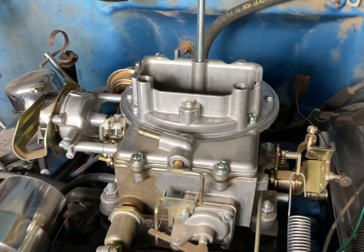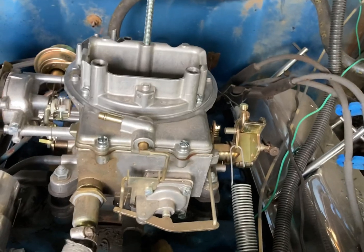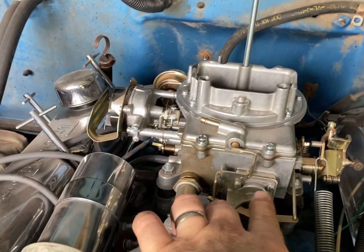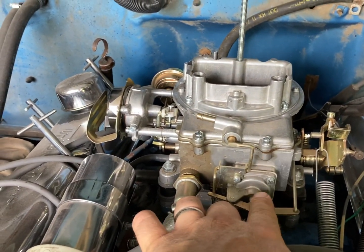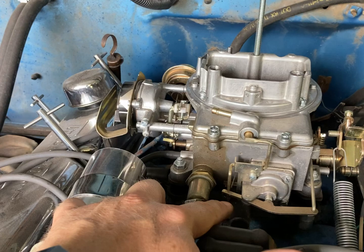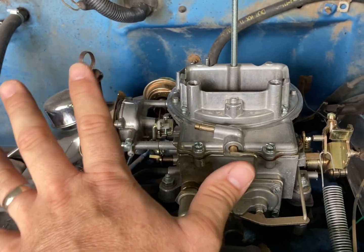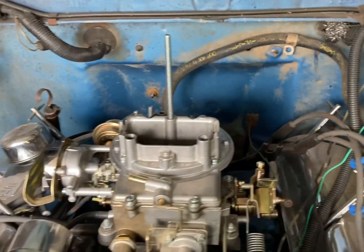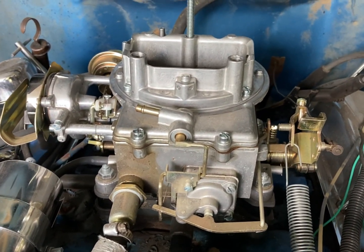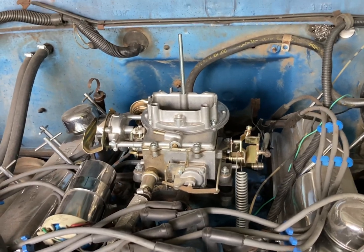Hopefully going forward this video helps you guys out, because I could not find anything anywhere aside from just a few write-ups on forums on how to get this done. In the future I might have to take out that diaphragm in the accelerator pump, drill the hole in the boost power valve, and up my jets — maybe. Considering I'm doing six to eight, ten pounds of boost, I should be fine exactly like it is today. Again guys, thanks for following along — go ahead and subscribe, comment, help my channel out tremendously. Thank you guys for continuing to support me. Until next time, God bless.